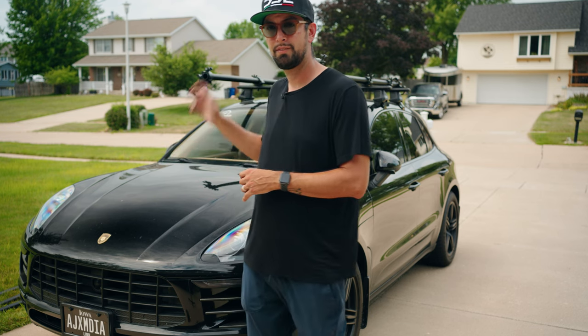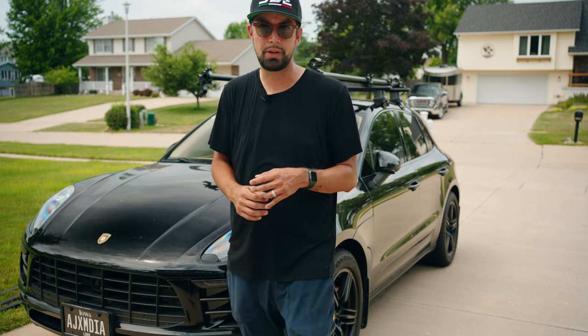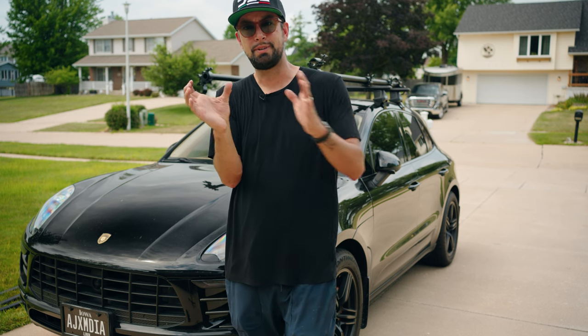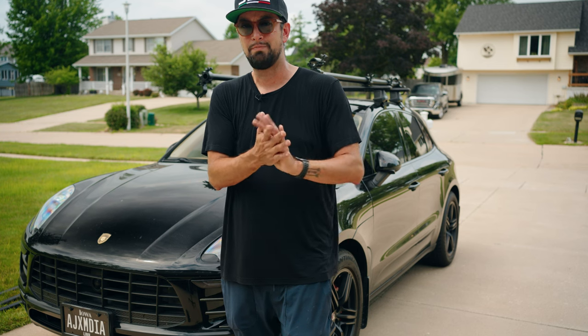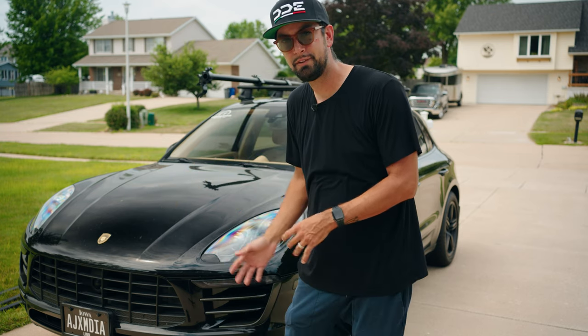You're gonna take the half clamp that we put on top of the Thule rail up there, and we're going to create a custom mount. And so what we're doing is we're going to have the clamp, some washers, the actual tow hook, some more washers, and then a lock nut. And so that is where the vertical for the front is going to come off of.